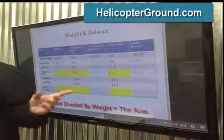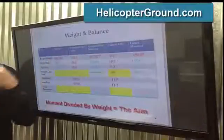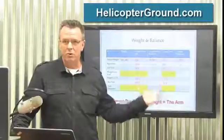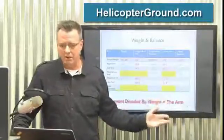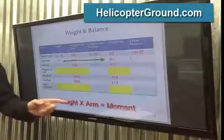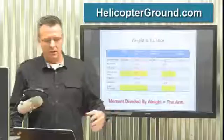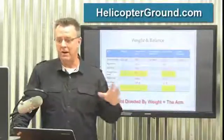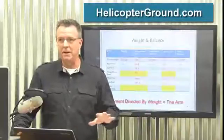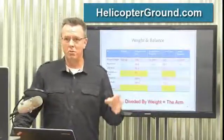So this is the presentation she's talking about right here. The numbers I have in red are basically pre-figured numbers. The blue numbers are what we're figuring as we work through this specific problem for this aircraft. The bottom line is: as long as you remember that weight times arm equals the moment, and that the moment divided by the weight equals the arm, you can pretty much work any weight and balance problem for any aircraft. It's a little unwieldy if you don't have a pre-made sheet, but you can do it as long as you remember the formulas.